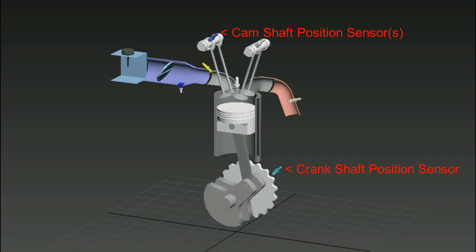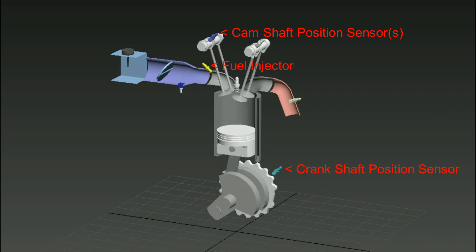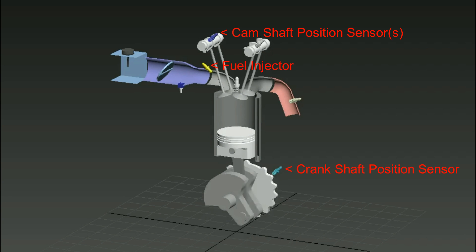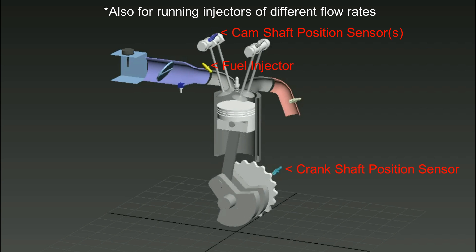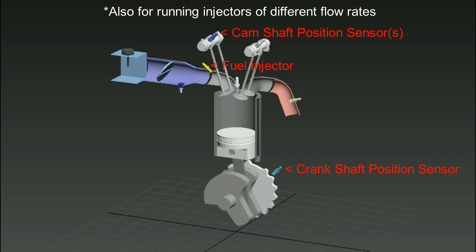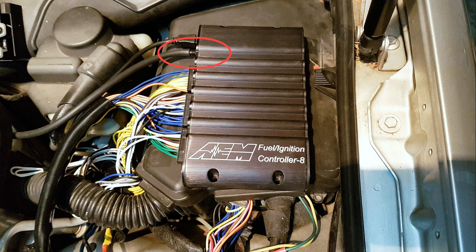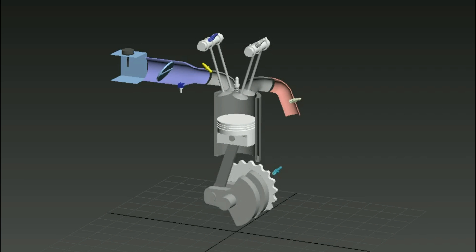The other circuit you need to intercept is the circuit for your injectors, so that the FIC can change the pulse widths going to the injector — giving you the ability to increase or decrease fuel at certain RPMs and engine loads. There's also an internal MAP sensor inside the FIC, so you need to connect a vacuum line from that to your manifold. By connecting just these circuits, you can actually get the FIC working and start your car.